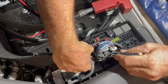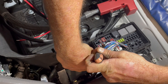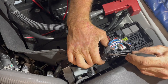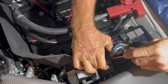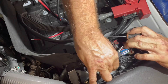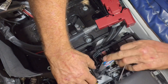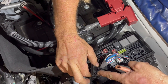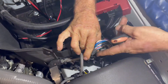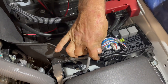So there are two little tabs — a flat blade screwdriver is perfect for it — just one on each side of where this plate goes on. That will release that whole part of the fuse box. Then just inside here, another couple of tabs on either side. One there, one on the opposing side — you can just sneak it down. That separates it and allows you to run the cable up in between there. Once you've run it through, you can just snap it back together and slide it back in. And that's how you install the cable into the fuse box.